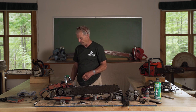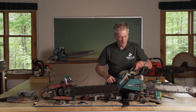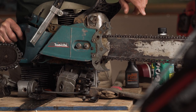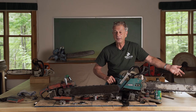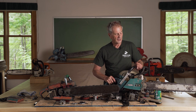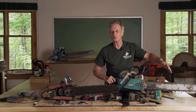For some reason, some manufacturers have decided to make theirs different. So this one here, instead of having the screw here or here, it has it here. So the screw is now perpendicular to the bar. So how is screwing this going to push a bar out? It's going to need a gear. So there's now a helical gear in here and those always break. And when things break, it's your fault, right? But I would suggest that this method of pushing the bar out is inferior.